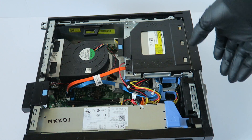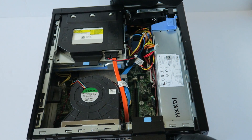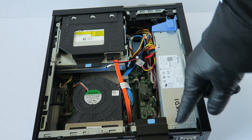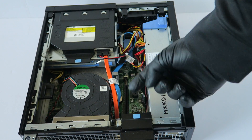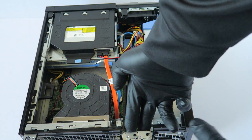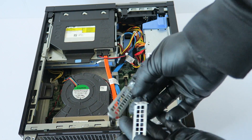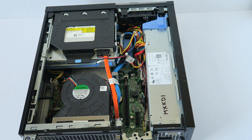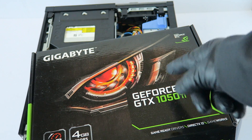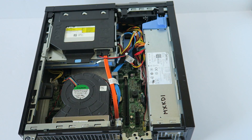The last part is the video card. I'm going to switch to the other side so you can see better. Move the little latch here for the PCI bracket — it's a low profile bracket. Remove the two PCI bracket covers here since the video card uses two slots. The video card I'm using is a Gigabyte GTX 1050 Ti.